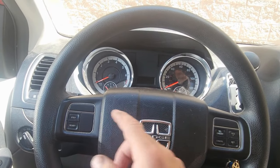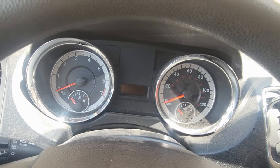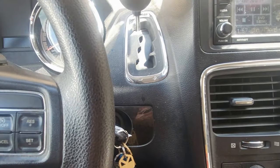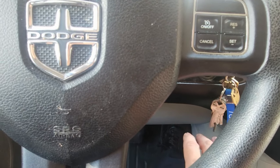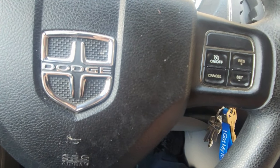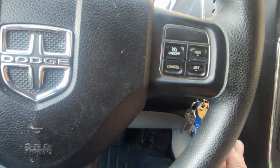With this one you're not going to use any of the buttons like most vehicles. You're actually going to use the gas pedal to reset it. Turn the key two clicks, and then within five seconds hit the gas pedal all the way down three times. You want to space them out — do it steady, not quickly.